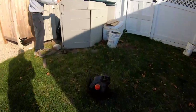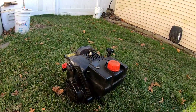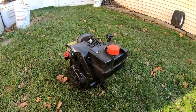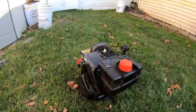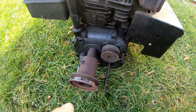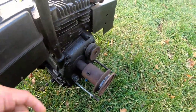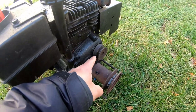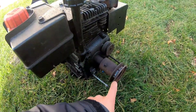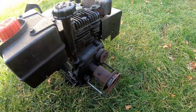Oh, dude, you don't have to whip them out, man. I'll just take a look at it. I think that's the first one. This is definitely a five. Or it might be a 3.5 edger one, too. This looks just like the one. It's probably a five then. But that looks pretty small, though. I'm thinking it's 3.5 because it looks like the same size. Okay, so I can't use this for sure, because I have like three of those. This is a double pulley one. So this is the crankshaft and that one's the camshaft. This one usually drives the drive pulley on the snowblower, and this one drives the auger pulley, auger belts. So I definitely can't use this. I need one that just sticks out one. Ones I kinda have. Oh really?